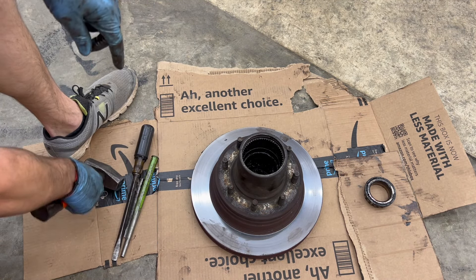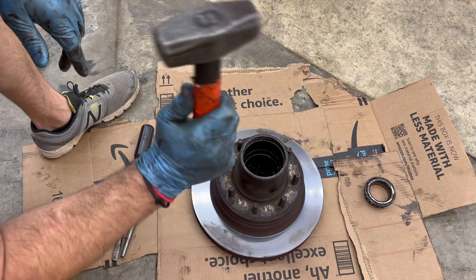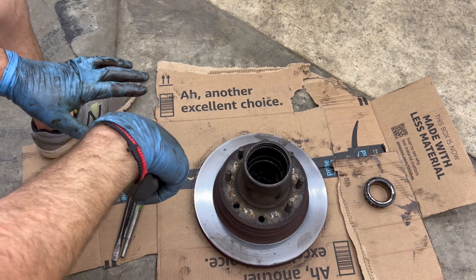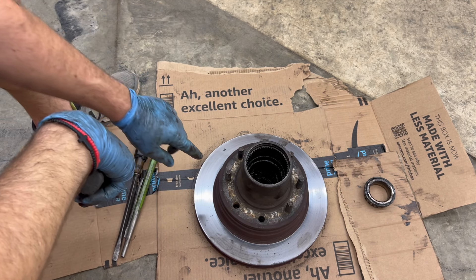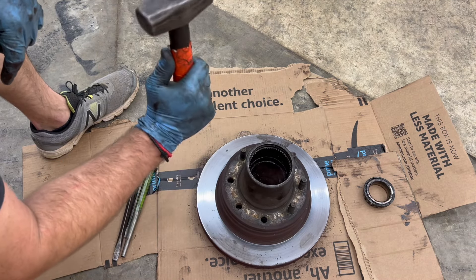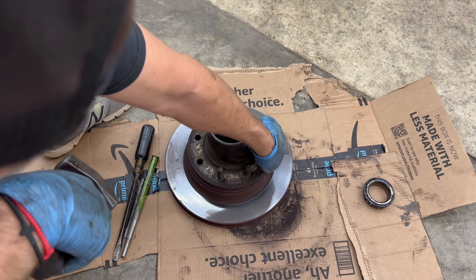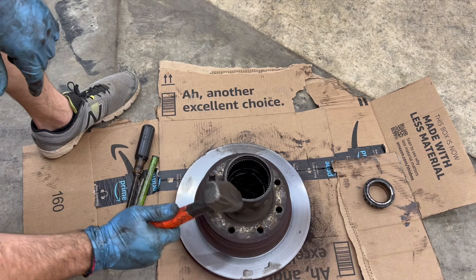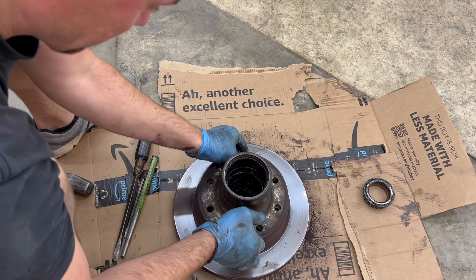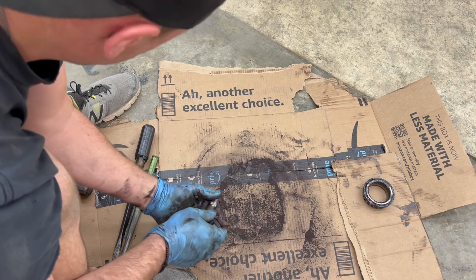What we've got to do first is get these studs knocked out, because you have to separate the bearing hub assembly from the rotor since we're replacing the rotors. It's not complex, that's all there is to it. You don't want to just absolutely beat the crap out of this if you're going to reuse the studs — if you're not, then do whatever you want — but just make sure you hit them square, don't hit them any harder than you have to, and just separate them. Now you can separate that from the rotor — this is going to be garbage. Set all your studs aside for now.